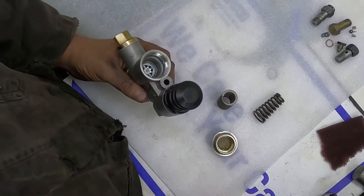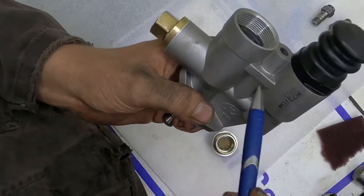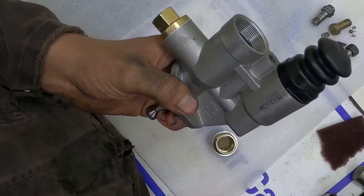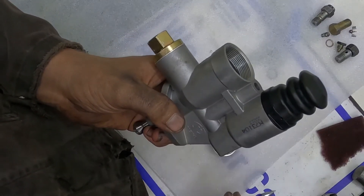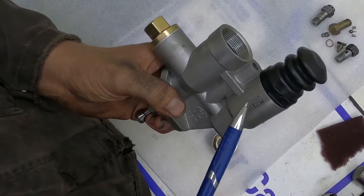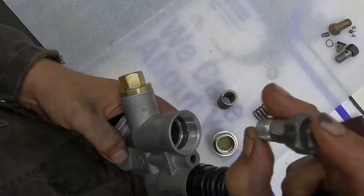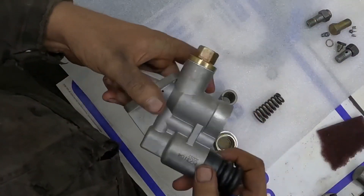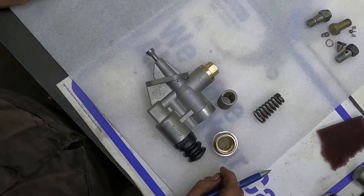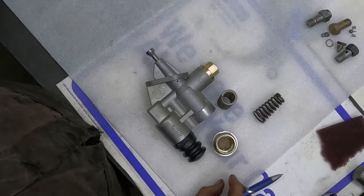Something else: if you're going to do it to a used pump, look at this port here — this one doesn't have anything in it, but some of the older factory pumps will have a relief built in here. If it has a relief built in there, you either need to plug that relief off or replace it with a new pump. I would recommend just replacing it with a new pump — if you've got a pump with one of those in there, it's an old pump. Because if you leave that relief in there, what'll happen is you overpower the relief in the pump versus overpowering the relief valve. Also check out the video on upgrading the overflow valves, because you want to do that at the same time as you're doing this — and the overflow upgrade you can do for free.